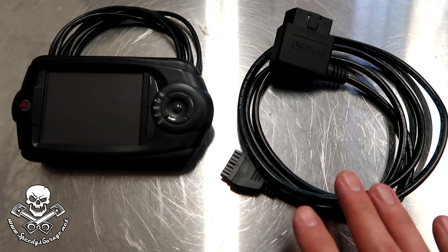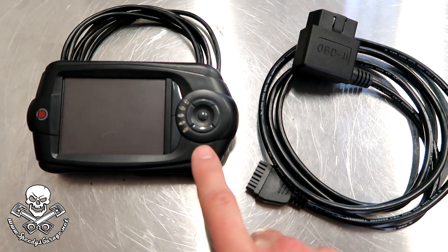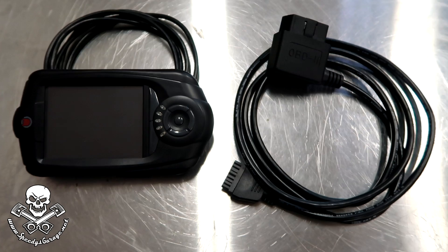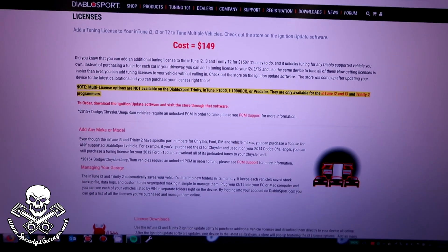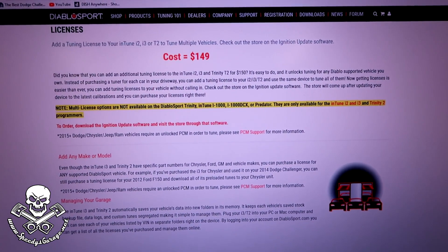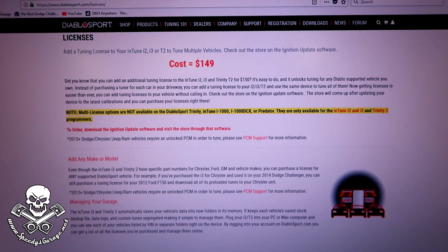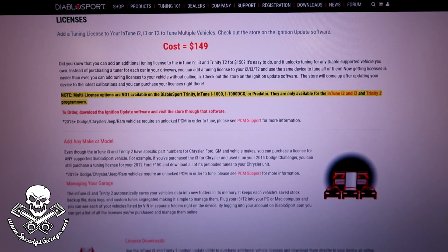One final thing: even though I'm going to tune the vehicle with HP Tuners, I can still use my Diablo Trinity to data log as long as I don't need something the Trinity can't detect. HP Tuners I think has a good hold on the wideband sensors in the Hellcat — I've never been able to get them to work on the Trinity. So initially when I'm dialing the tune in I'll probably need to use the HP Tuner software with a laptop, but once it's dialed in I can go back to just using the Trinity on the windshield. Just to be sure, I went and checked and Diablo does now offer licenses similar to HP Tuners, but only for specific tools — the Intune i2, i3, or T2 — and an extra license is $149. I'm still going to use HP Tuners to try something different and because the software being included sold me on it as my tuning solution.